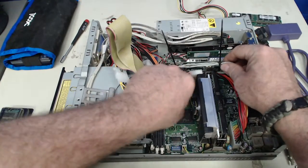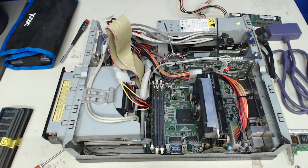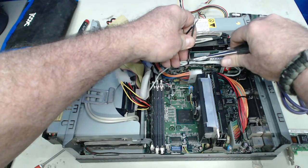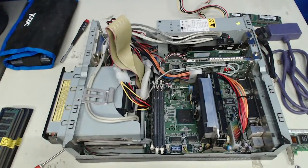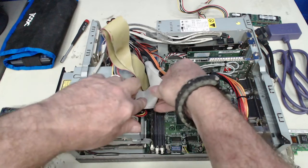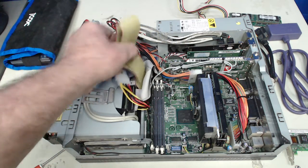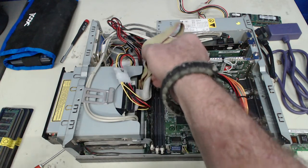And this ATX power connection here, I don't want that tied on the back of that ATI video adapter either. And the heatsink is just on the other side from where that junction is. See, and that'll tuck real nice in there. This will tuck down. I may have to come up with something eventually for this cable, just to strand it or some other way so it doesn't put as much side pressure, not in that tight with that DIMM module. And that may be just something I have to look at.